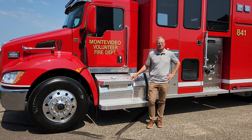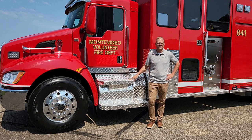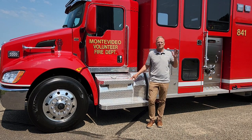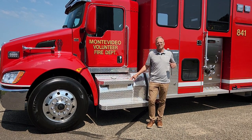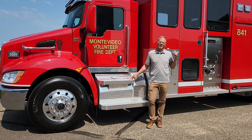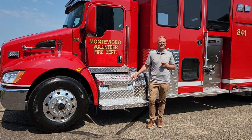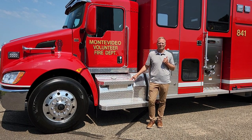I'm Wade Carvita and behind me is a new full response pumper for Montevideo, Minnesota. This video focuses on the Montevideo pumper that we just built. This truck is built on a Kenworth T370 chassis. It features our full response crew cab with seating for four and inside top mount pump controls. It has a rescue style pumper body with a thousand gallon poly tank and a Waterous 1500 gallon per minute CSU fire pump. There's a lot to show you on this truck so let's get going.